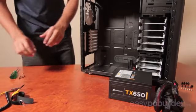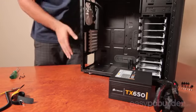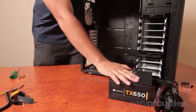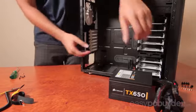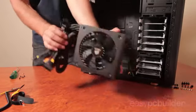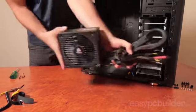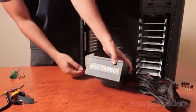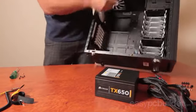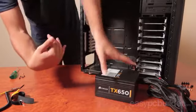Now, to ensure that you're appropriately grounded to earth, you should do the following. Unpack the case and the PSU before unboxing or touching any of your other components. Install the power supply into the case. Now you notice a fan on the bottom of this particular model which feeds air into the PSU. Where you have an intake and filter in the bottom of the case, install it this way as it will help you draw cool air in and through the case.